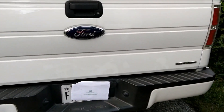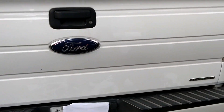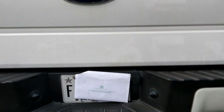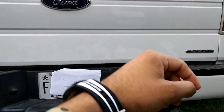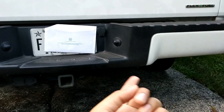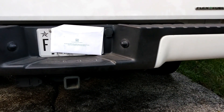In this short video I will show you how to remove the tailgate on an F-150. It's very easy. The first thing you have to realize is that if you have a rearview camera, you will have to unplug the wire connector, which is located on the passenger side, underneath the box, next to the spare tire. You can go ahead and unplug that wire.